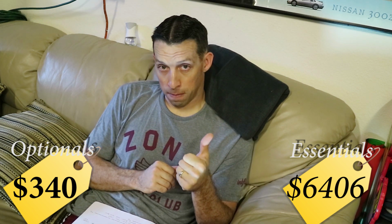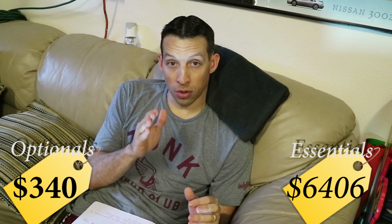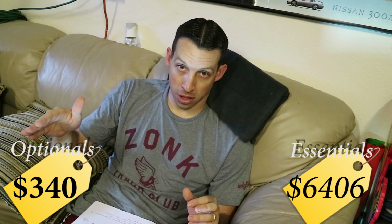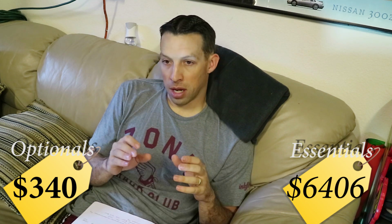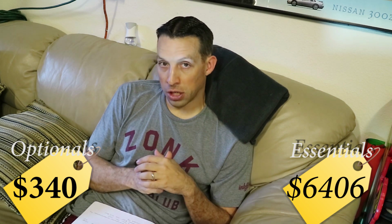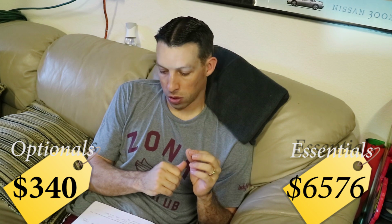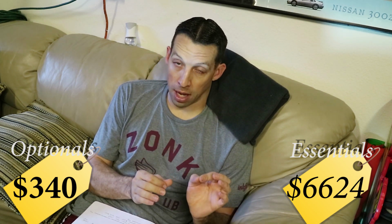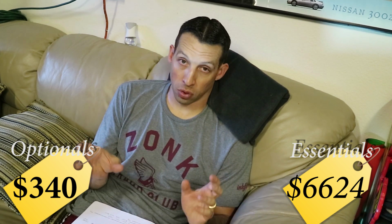You're going to need air filters. You can go dual MAF, and if you do that, you're going to increase your cost and your difficulty. You could go ahead and use the ECU that comes with the engine. If you do what we're going to talk about a little bit later, and that's an aftermarket ECU, then you can go map sensor, and all you need is 2 air filters. Now, I chose to go with HKS mushroom filters. That was a total of $170 for those 2 mushroom filters. And then, of course, I needed couplers for those, about 48 bucks on Amazon for the right couplers to mount up all the air filter stuff to the turbos.